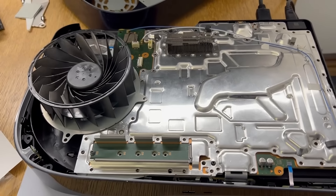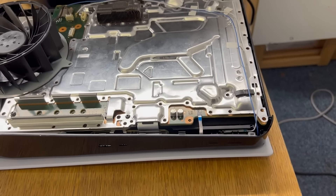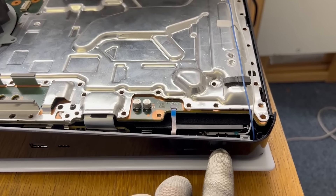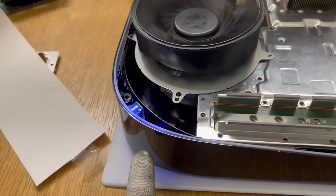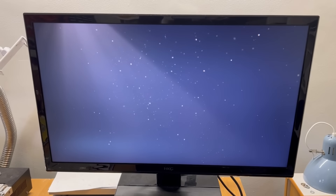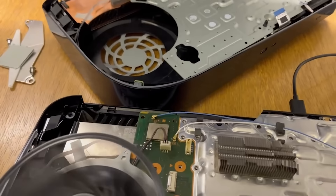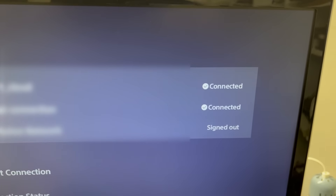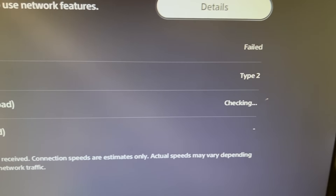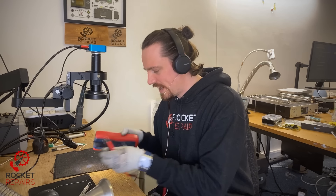The PS5 has now been put back together with just the fan placed on top. Here we go — let's turn it on. Yes! We get power and fan spin. It stays on. And we get something on the screen — wicked, that's the result. Now I just need to check Bluetooth and Wi-Fi. Great news — the Bluetooth works. I can also see that we are connected to Wi-Fi, so that works as well. It's doing a download speed test — 21.7 meg down. And just like that, we've managed to fix it. Yes, I went around it the long way, but it didn't take too long to re-ball the Wi-Fi IC. Most importantly, we're going to have one happy customer. Thanks for watching.